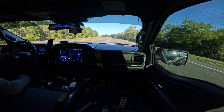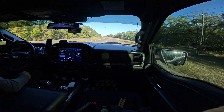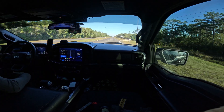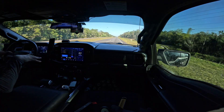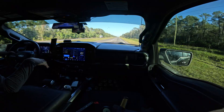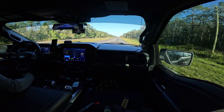I had at least a 10 mile-per-hour crosswind and no issues with sway or anything. This is an open trailer we're carrying and I have good sway control. Not to mention this car is heavy to begin with. The modifications to the truck to help it tow better include LT tires — BFG T/A KO3s — and it has a rear sway bar. And again, I have a lot of experience towing.